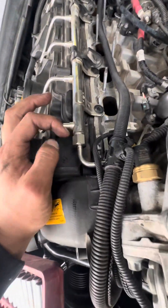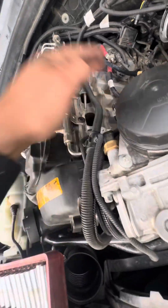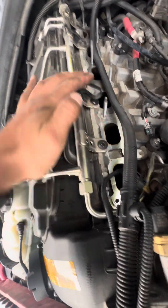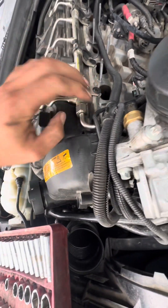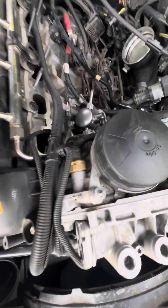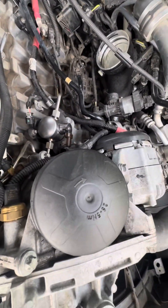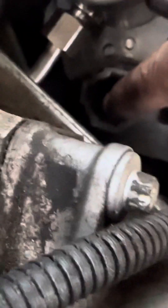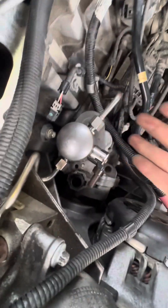Up here this fitting is not going to just go in because the pump is a little taller. So what I did was I removed these two bolts and this gives me slack to go up a little bit, I threaded it in, and then if I push down on it a little bit I can get the bolt back in. And that should do it — it's that easy. All I've done so far is make that little cut right there just to clear the brake booster line, and this is how it's going to sit.